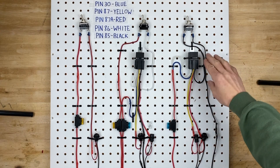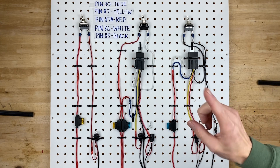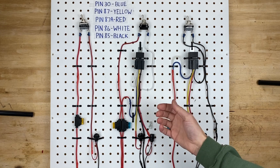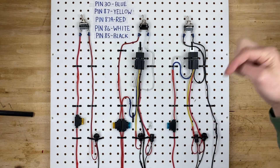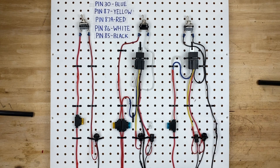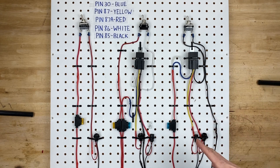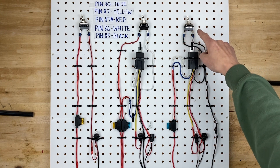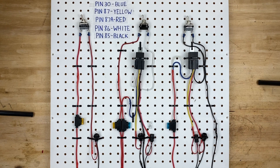One common reason you might use a negative trigger is with horns in a car. Most horns only have one wire going up the center of the steering column to the horn button. With a positive trigger you'd need a power wire going up and back down the steering column, but with a negative trigger the steering column itself is grounded, so you only run one wire up and the other side of the switch grounds right to the steering column — one less wire through that limited space.